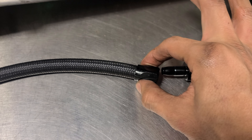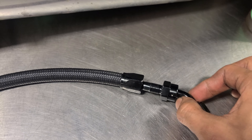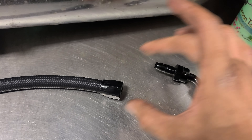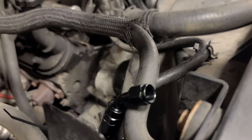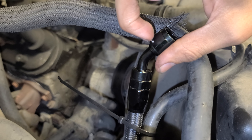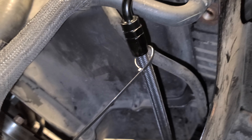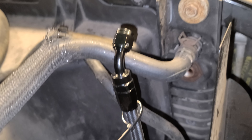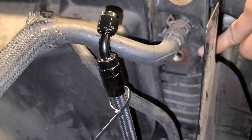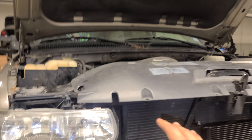Put the fitting into a vice using AN-specific vice clamps, get a wrench and spin it down, and you'll have a correct AN fitting. It'll look like this: hose, AN fitting on there with the angle tip, and the fitting is free to turn wherever you want — that's going to go on the radiator. If you want to convert your radiator fittings to dash-6, figure out what fitting size and thread pitch that port is, get an adapter to go to dash-6, and that's it. Feel free to route and wrap the hoses following a factory routing diagram.